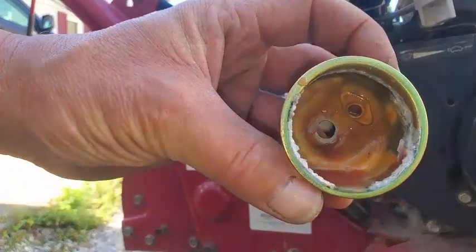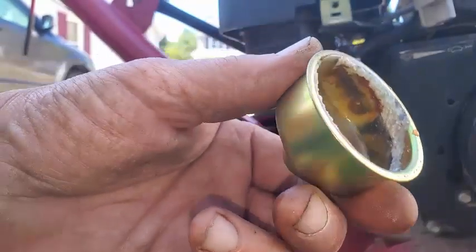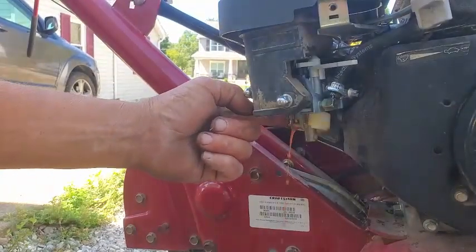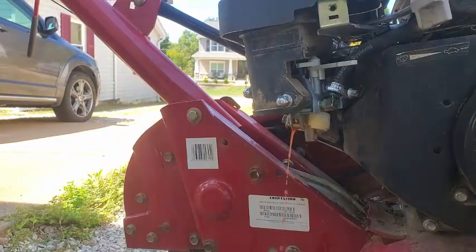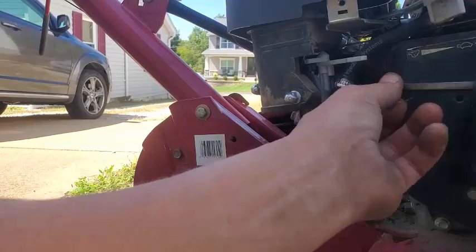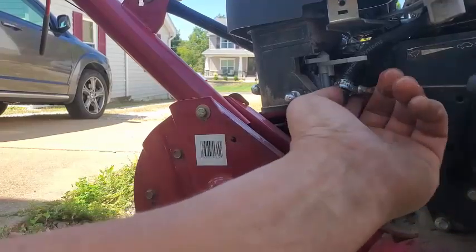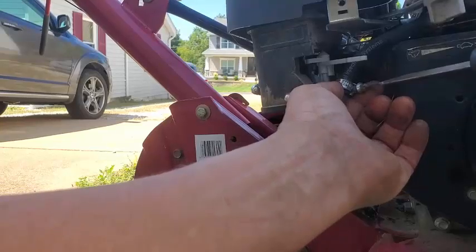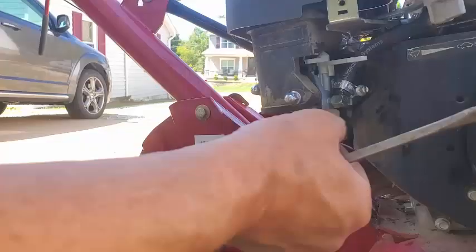So we've got a little crud going on up in there. We could wipe that out. So at least we know where the float works. Probably just get this bad gas out. A little rust in the tank - pretty normal. I don't know if it's going to require de-rusting. Probably be a good idea to put a fuel filter onto this thing.